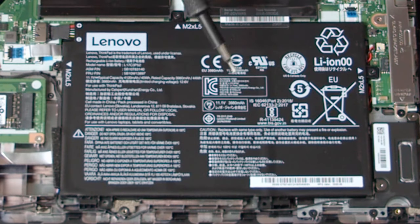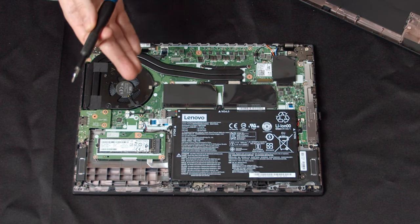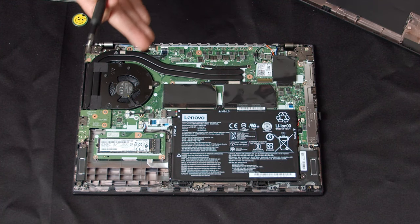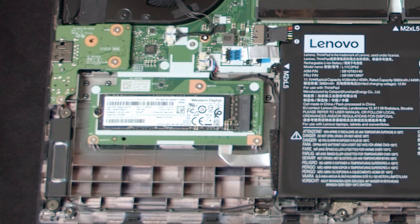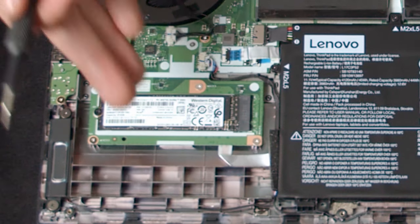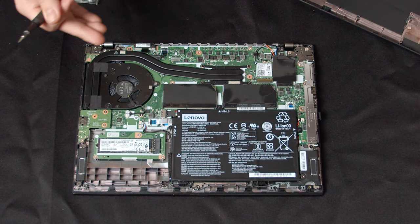The battery seen here is also not glued in and can be replaced if the need ever arises. So far the ThinkPad L14 gives you every available upgrade option, but one caveat remains — the PCIe SSD sits in the M.2 SSD slot. As there is no SATA connector on the mainboard of the ThinkPad L14 AMD, you can only switch out and upgrade the one and only storage option. All in all, the upgradability of this laptop is still pretty damn good though.